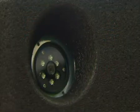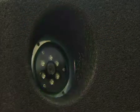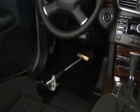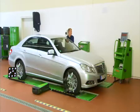Top technical efficiency and precision are ensured by the integrated camera system of Bosch. After the brake pedal lock is positioned, the caster angle and the kingpin inclination are determined using the 20-degree left-right steering procedure.